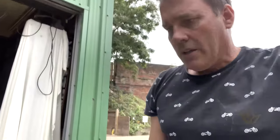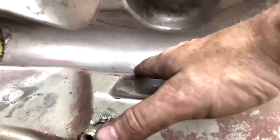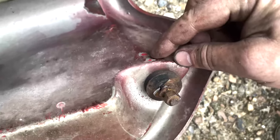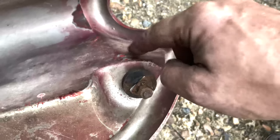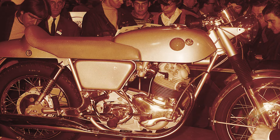Especially its pedigree. Let me show you the color that was on this bike originally. The seller had said what he found, what he thought was silver underneath here — and sure enough, this is silver. This looks original, because if you see the rubbing, the red on the inside is actually the gel coat of this fiberglass. That's the gel coat because it's obviously far too bright for paintwork. But underneath you'll see the silver — there's no paint in between that and the gel coat. And this other purpley stuff, that's a burgundy on here. So it's most likely this motorcycle was originally silver, as they were in the early stages of the manufacture of these bikes.